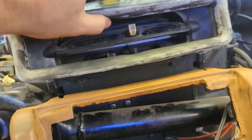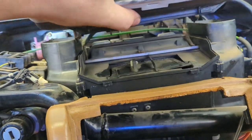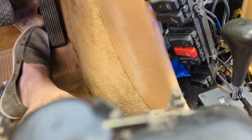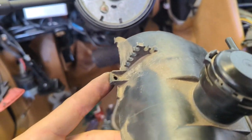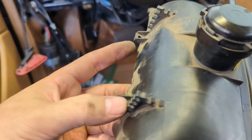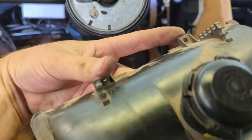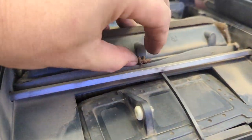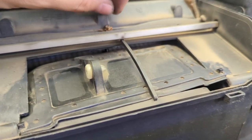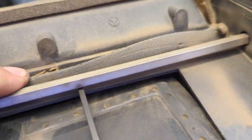With that, I just used the only screwdriver that fit in that area — it's one of those reversible toolkit screwdrivers. You can do it by feel or use the little mirror, get it on there, take those out first, then the ones on the side, then the clips last. With those off, start from the front, lift it up, and there we go — it all comes out. I've already disconnected my vacuum line. There's a spider in here, let me take those pieces out.